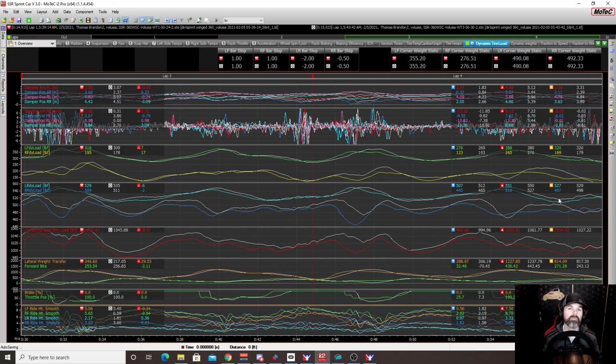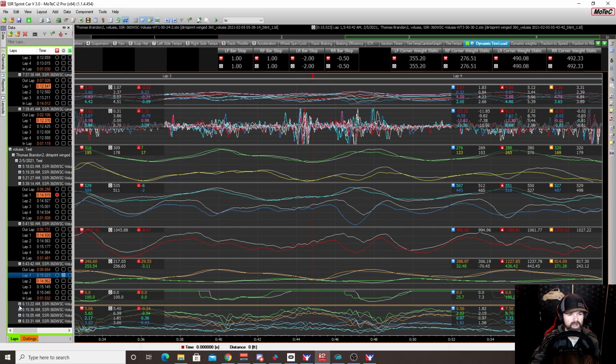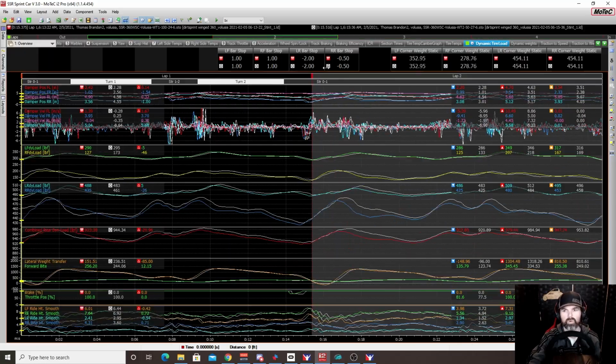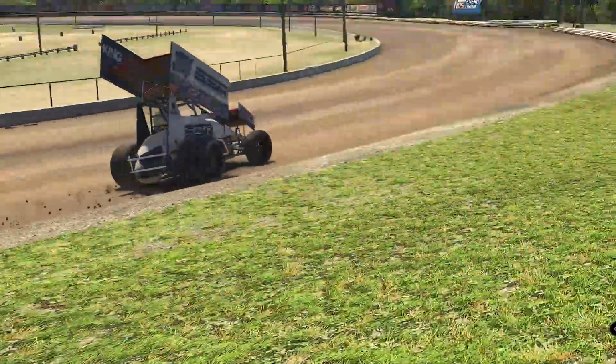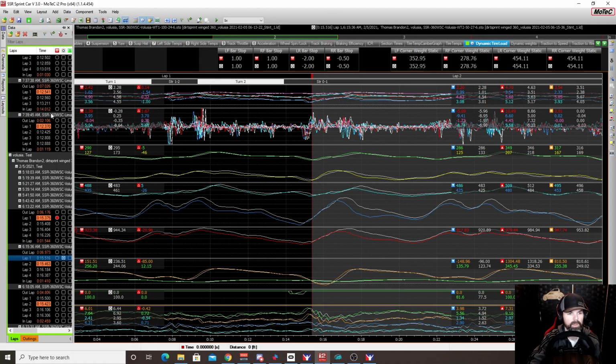So that was 50%. Now, when we got to the 100% track, this is really where we saw the biggest difference. So around the top, and the track was pretty slick, there was still a cushion that you could run. You could still basically run wide open around the top. You might have to burp it here and there, but for the most part, you were wide open around the top. When we were looking at the 24 versus 27, and we had the wing at -6, 24 degrees was definitely faster. Okay, we were saving a tenth of a second.